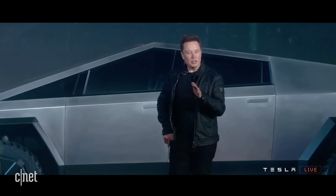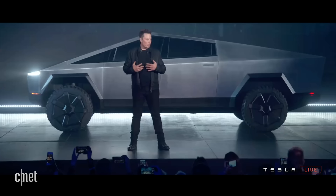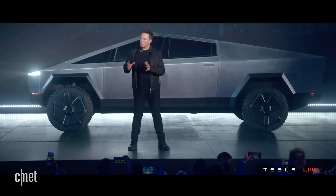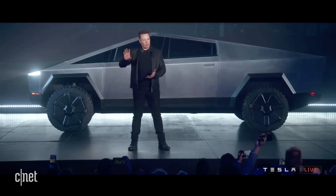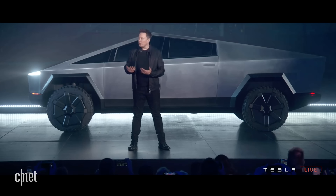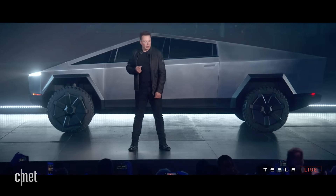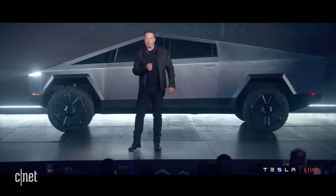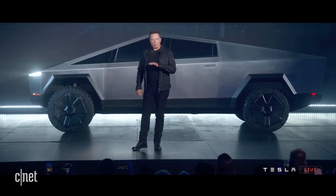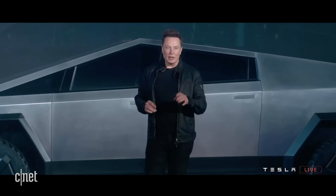So we didn't cheat in either width, height, or length. Part of this is the fundamental design change — we moved the mass to the outside. We created an exoskeleton. Normally the way a truck is designed, you have a body on frame, a bed on frame, and the body and bed don't do anything useful. They're carried like cargo, like a sack of potatoes. It was the way aircraft used to be designed with biplanes. The key to creating an effective monoplane was a stressed skin design — you move the stress to the outside skin. It allows you to do things you can't do with a body on frame.